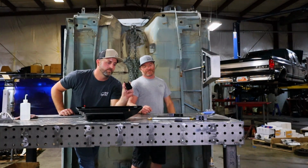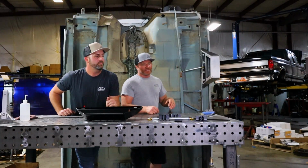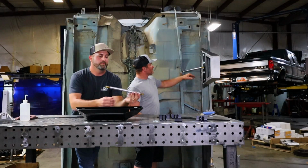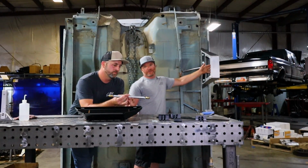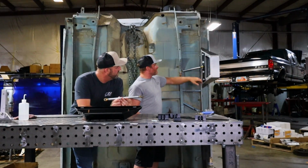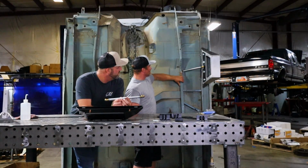That's for crew cab trucks. If you have an extended cab truck or Bronco, it's going to look a little different. And then what we do is use 2 Heims and an aluminum threaded rod, and it structurally ties in and pushes all that weight. When you go to step on it, hop on it, jump on it, get the kids out or whatever you're doing, it pushes it from not just the rocker area, but all the way to this rib so that it doesn't flex.